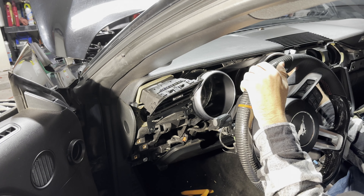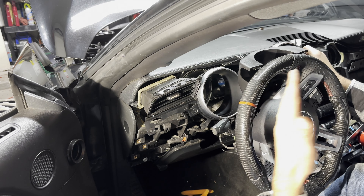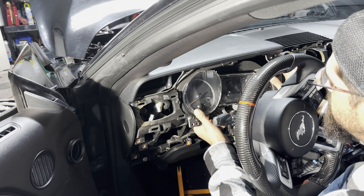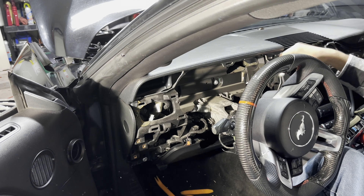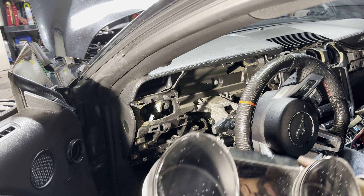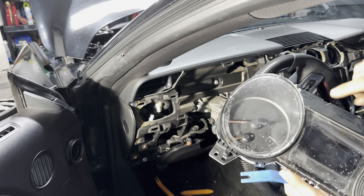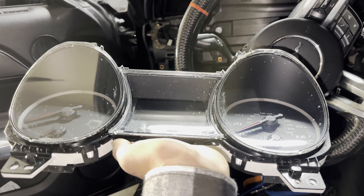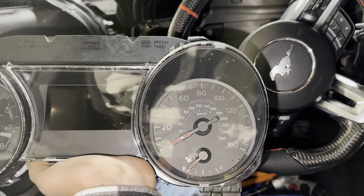You should have plenty of room. Pull the plastic shield up and you'll be amazed — the plastic is very flexible. Finally got the cluster out. Go ahead and pull out the cluster; there's going to be a connector behind it. There's a cord holding it in place with a little tab button. Now that you can see everything, I'm going to buff the cluster completely out — it's factory analog and whatever got all over it needs to come off.